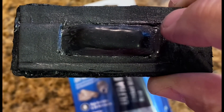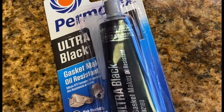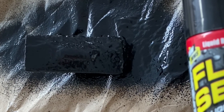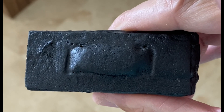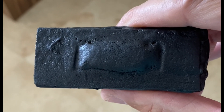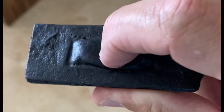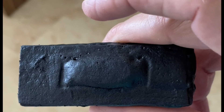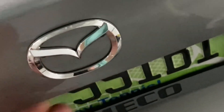This is probably overkill, but I filled the gaps around the edges of this membrane with some Permatex gasket sealer which remains flexible, and applied a couple of light coats of Flex Seal to seal the entire switch from the elements — no moisture should be able to get in now. Here's the finished product; it's not quite as pretty as I would have liked. I tested it with an ohmmeter, the contacts work, and I installed it in the car. Voila — it works!